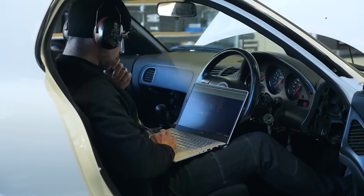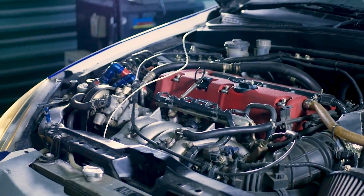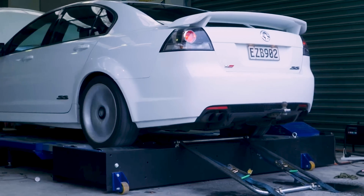I totally agree — I was in that situation many years ago where I had a really good background tuning standalones, but hadn't done much with reflashing factory ECUs. You're scared of what you don't know; the process is different, the tables look different, the operating principle of the factory ECU is very different to a standalone. But for a basic bolt-on build — an air filter intake, headers and exhaust — if you're tuning a standalone, you're tuning everything from scratch; every single table, every cell needs to be filled in. That is by default a time-consuming process. On the other hand, tuning from a factory ECU with a base calibration, you might only need to adjust a handful of parameters, so the tuning can be a lot quicker.